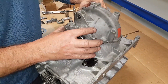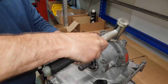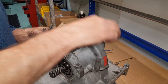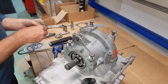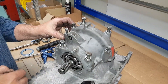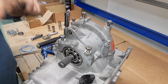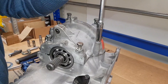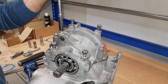Okay, we're now going to put the bolts in. We'll put the large ones in first — these are the 3/8 UNF ones, so one, two, three, four. Small ones go in afterwards; these are the 5/16 ones, so one, two, three. You'll notice we've just brushed the heads of these off to make them nice for the video. Just spin those in — pulling them all down but not torquing them down at this point, just so the silicone squeezes out.